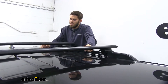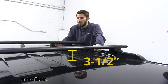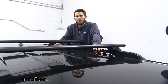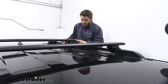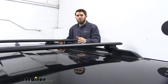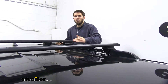Now I want to go over a few measurements. First, from the top of our roof to the bottom of our crossbar, it's going to be three and a half inches — that should be more than enough space to get your clamp-on accessories underneath the crossbar without risking damaging your rooftop. From the top of our side rail to the top of our crossbar is two and a half inches, which is something to keep in mind for low clearance situations like parking in your garage with this added height to your raised side rail.